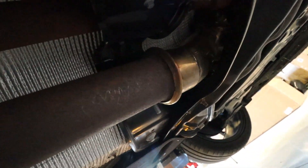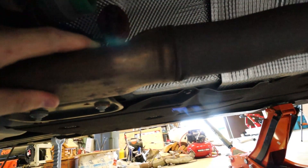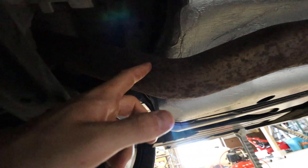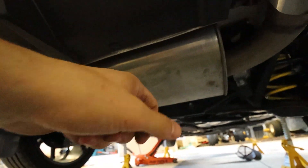There's one connector you have to take off for the flap - I zip tied it up so this thing stays open all the time. Coming under the car you can see how rusty it is. Right in the middle here is a super restrictive connector that's obviously welded in. Coming up to the front, the down pipe is brand new and the v-band is brand new. I'm going to make a cut right up here where there's the least amount of metal, and then right down here by this bend - get this cut out of the way and the whole muffler can drop straight down.